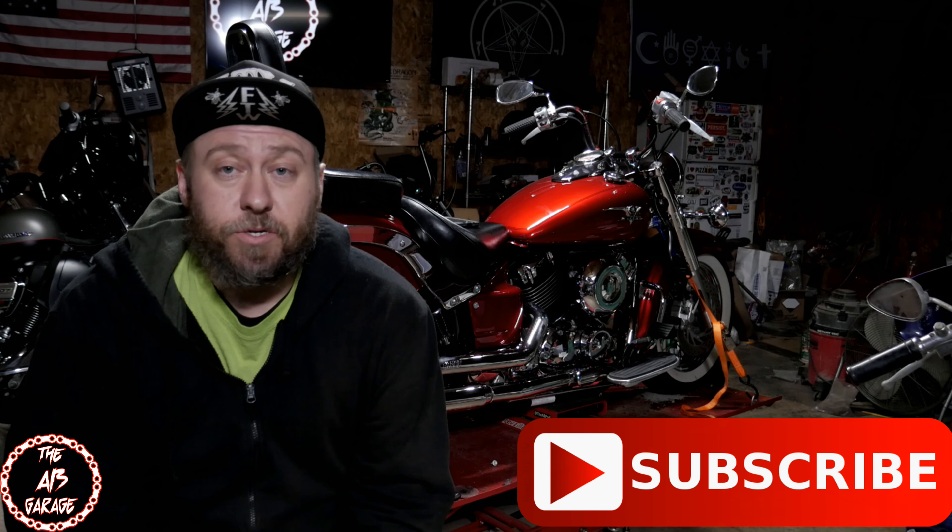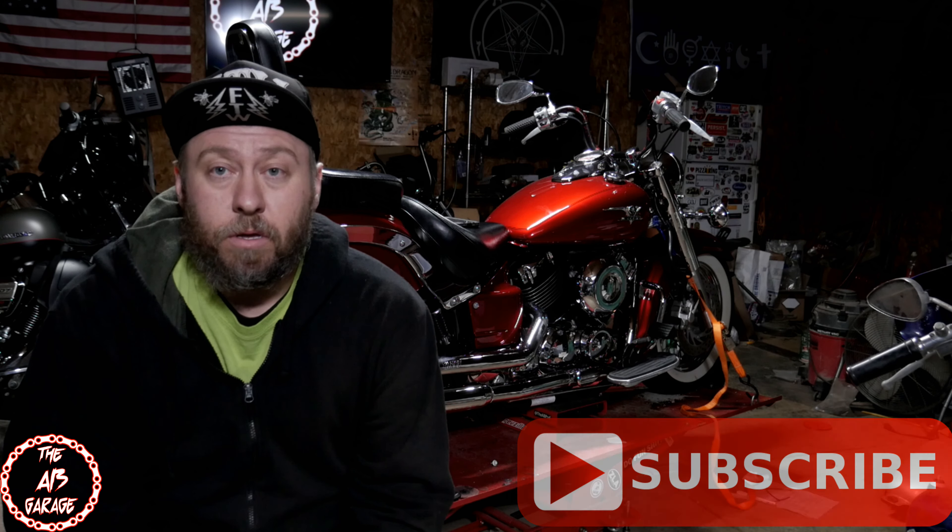Pretty much for free, other than a little elbow grease. You just pull the top bolt nut off, drop your spring out, and move the hole about an inch forward, I think it is. I'll be showing you my process going through it here on this bike, but a lot of guys have done it and said it works great. Worst case I gotta move it back and I'll have an extra hole in the frame. So I'm gonna go ahead and get into stripping this bike down so we can lower this thing.